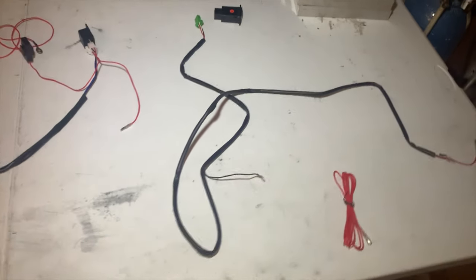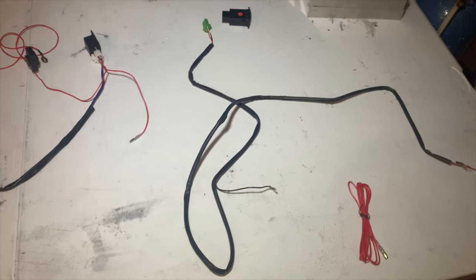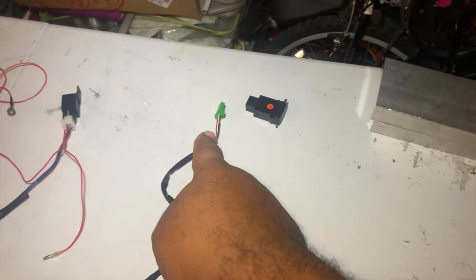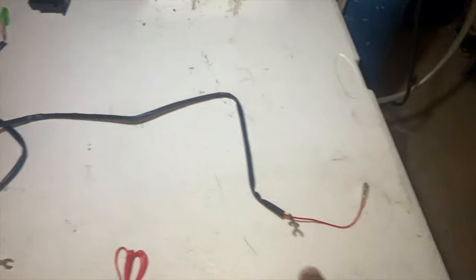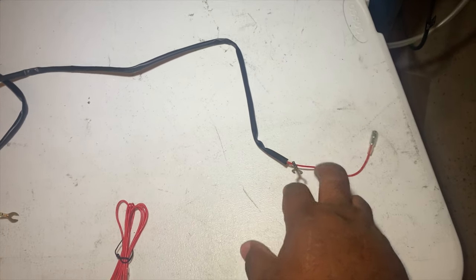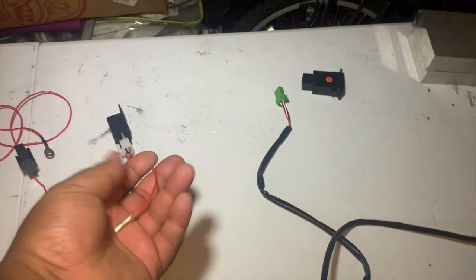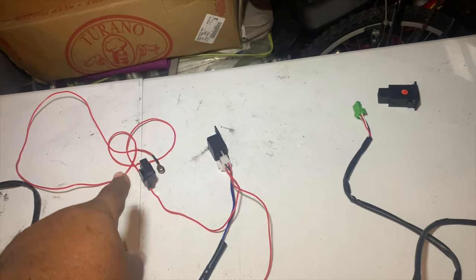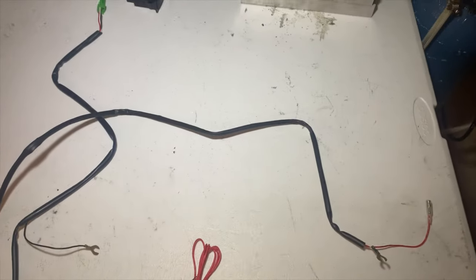I'm going to explain this fog light harness as simply as possible so there are no confusions. So this is our switch — this plugs directly to the switch. At the other end of the switch is what you're turning on and off for power. This is the ignition switch signal, which is white. Then this is an extension, just in case this isn't long enough to reach the relay. You're turning on and off the relay to give power to the fog lights. There are some grounds along the way. That's the relay, and that's the fuse for constant power, so that connects to the battery. And that is our wiring harness.